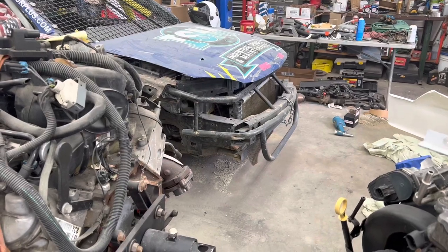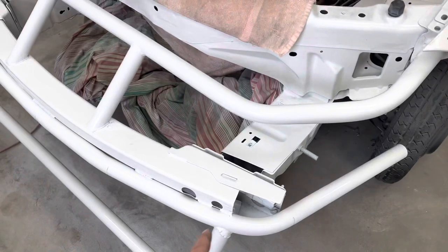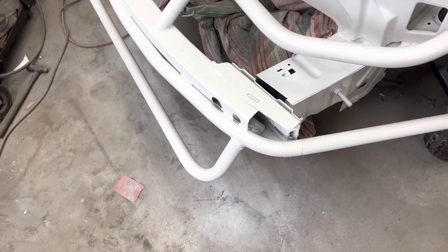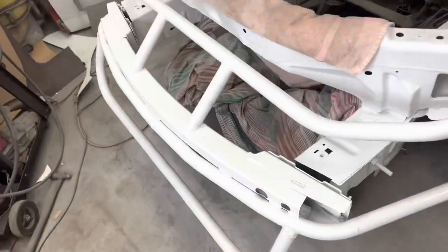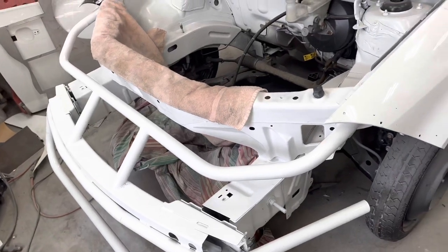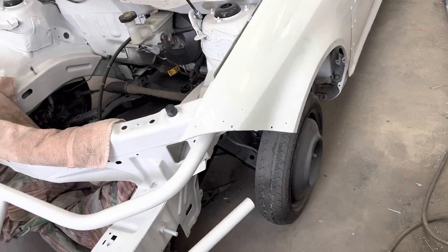I was thinking it would land somewhat in the center section there where it's still in the bumper area. On this one, it is slightly past the edge of the bumper. It's into the curve. So I actually had to use a pie cut to fill the hole, but it's not structural. It's a bumper. It's holding the nose piece. It'll do its job just fine. Yeah, I'm going to cut the center out of that nose, and then the next time you'll see this, that nose will be permanently riveted on there, and we will address the wheel wells and cut and trim the nose piece and everything to fit that wheel well. So here we go.